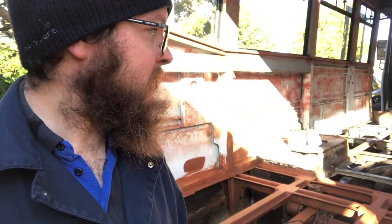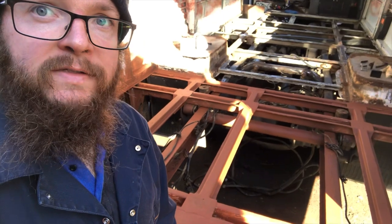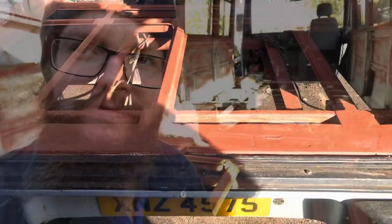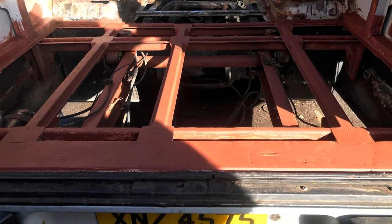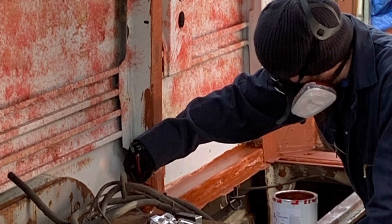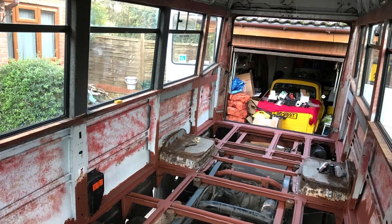The past couple of days I've been needle gunning, angle grinding, and sanding back the top chassis rails and they've gone really well. This morning I'm applying some rust encapsulator and I've got this far - it's taken me about an hour and a half. I'll crack on with the rest of it and hopefully do a second coat. This stuff dries really quickly but I can't paint that fast, so wish me luck. The painting went on throughout that day to get two coats on there. I decided to wear full PPE because this stuff is really smelly - would recommend that to anybody - and even though the bus had no floor it really did stink.